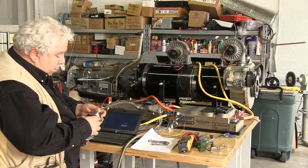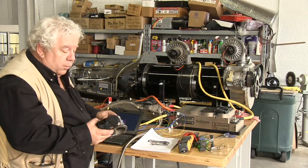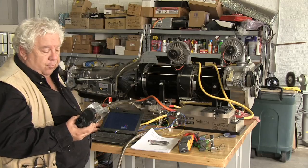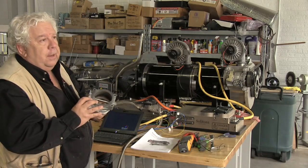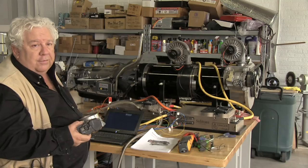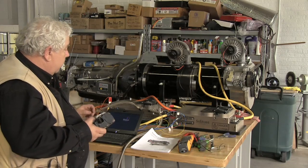This is a 5-volt pot from Revolve that we were going to hook up to the butterfly valve. I've pretty much decided not to. We have adequate documentation on these signals. We're going to pick them off and try to see if we can use those as the throttle input signal to the Soliton 1 without disrupting that engine control unit. If we can't, it's probably a matter of putting in an opto isolation circuit to not load it, and again do the same thing, steal the signal and send it to the Solitons.